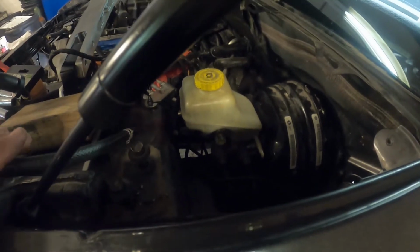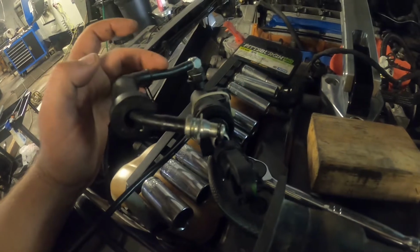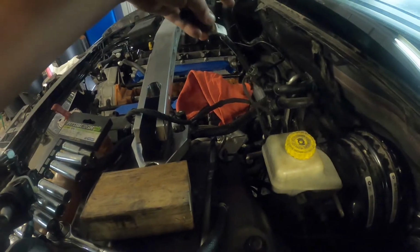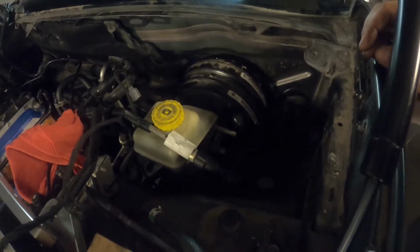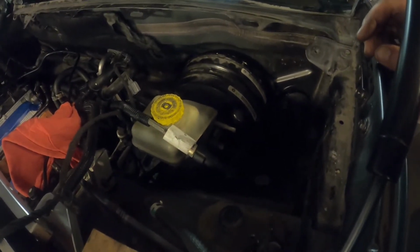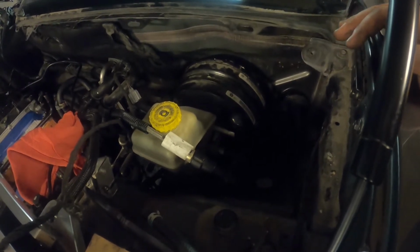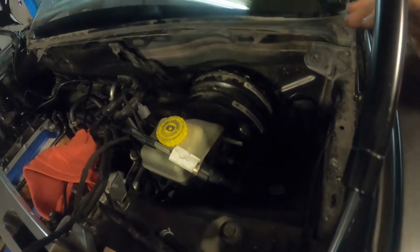And so I need to get that line out of the car into the engine compartment, as well as the factory connector for the actual clutch line down to the slave cylinder, which is run right up here right now. We're probably going to go under the booster. There's a few spots we can tag in over here. We have a wiring harness coming out of one and then the hood pop out of the other, so it should not be an issue to be able to get those routed and through the firewall where they need to go.